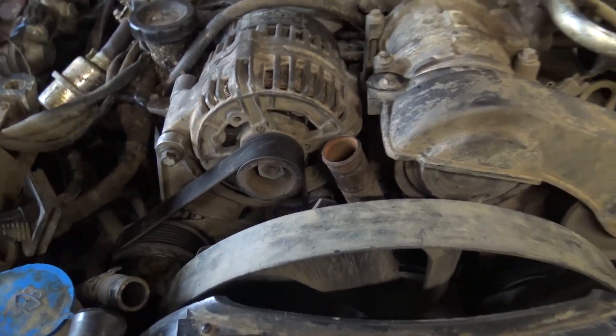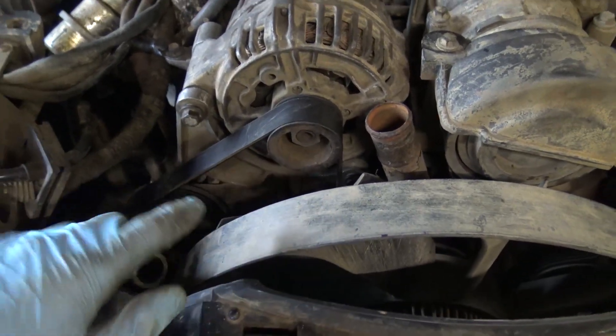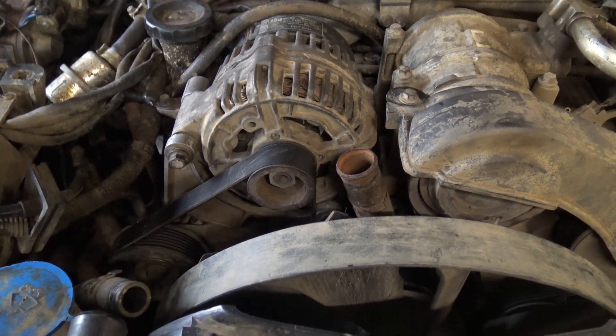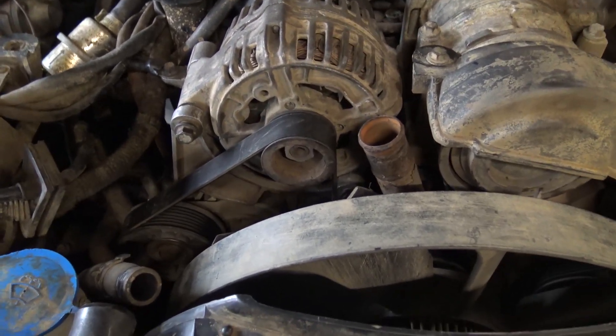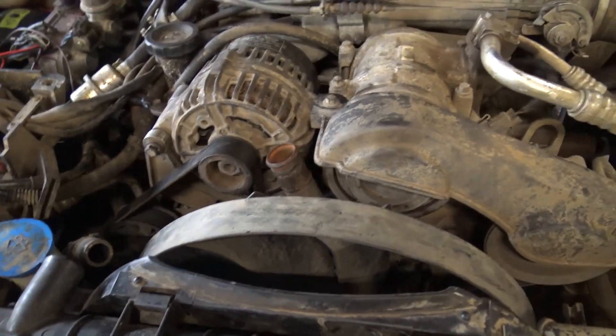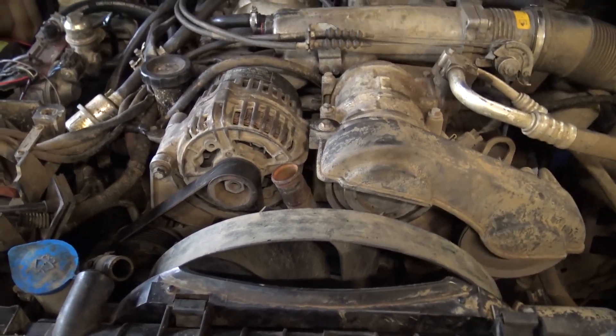We have the oil temperature sensor on the top, oil pressure sensor in the middle. I did have to modify the alternator bracket slightly on the bottom bolt mount to accommodate it, as it's quite a large pressure sensor. Obviously if I was using a capillary gauge that could be avoided. On the very bottom there's the oil take-off. I've run the engine up and there are no leaks. Underneath there is the nice clean sump with the turbo returns in it.